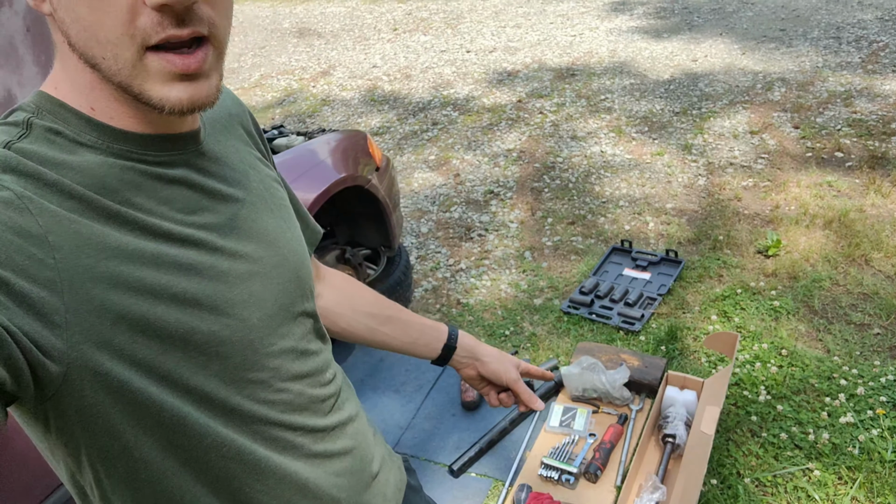But anyway, back to the car. So the boot ripped on the axle, and I knew it was a matter of time. I'm under the car all the time. I saw it, and it was only a matter of time until the axle's no good. When I was there, I put a little grease in the joints to try to prolong it. Then I started hearing a little bit of clunkiness up there. So I had already been saving up for the axle. I have that on hand.